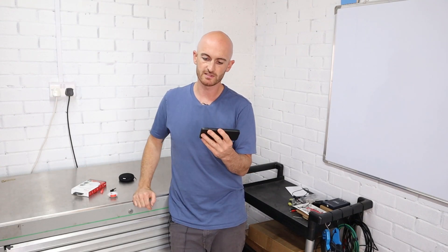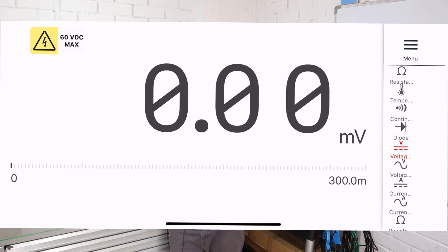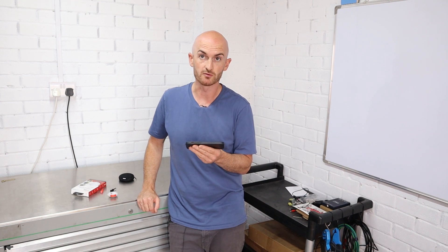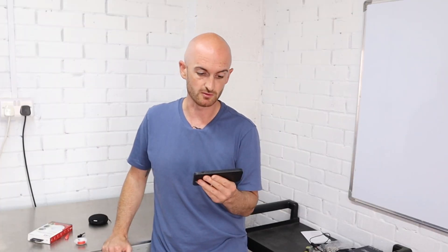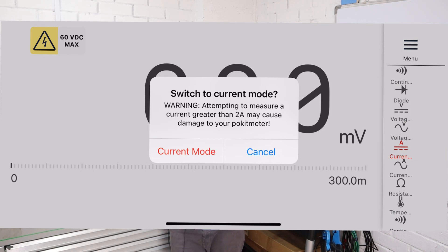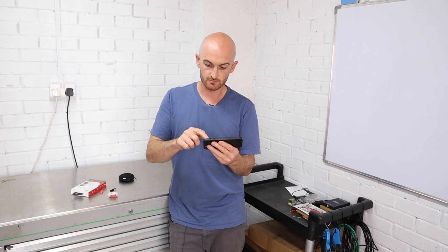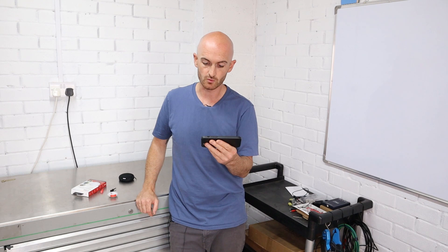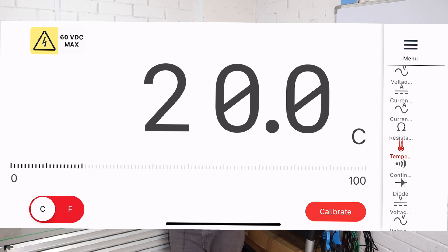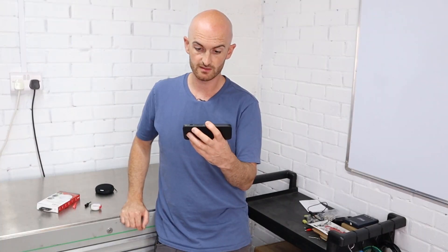We had a full battery health showing on the display. In multimeter mode we've got all our features down the right-hand side of the screen: voltage settings for AC and DC, with a maximum of 60 volts DC — that is the maximum input in oscilloscope mode as well — which should cover most tests we'd expect to do on a car. We can select current mode and it gives a warning in case you forget it's in current mode and connect it across the battery, as you'd pop the fuse. Very thoughtfully, Pocket Meter did include an extra fuse in the box. There's also a temperature setting with a temperature sensor inside the unit — showing a balmy 20 degrees here in the UK — plus continuity, diode test and resistance features. Loaded with functionality.